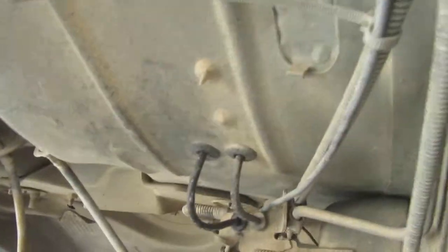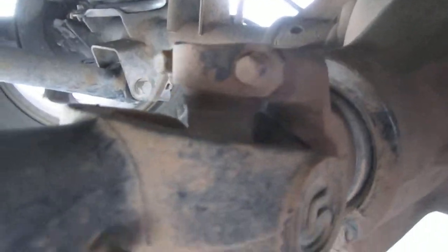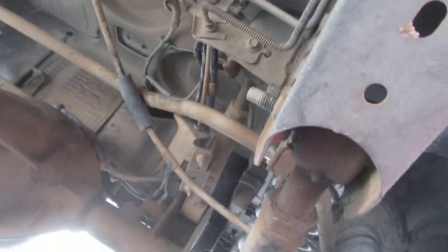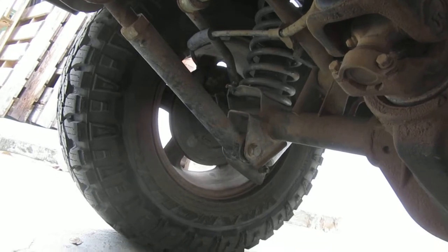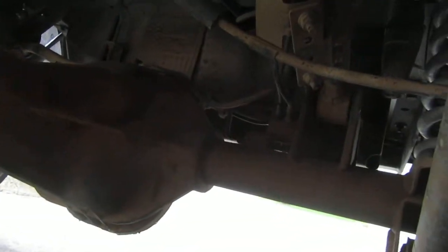You go down here — that's where the wires come out. The one on the right is for the right rear, the one on the left is for the left rear. Following along, it goes up on top of the differential and hooks up over there. I replaced that sensor but it lasted only about three or four hundred miles before the light came back. We figured out the right rear bearing is going out, and all the metal shavings are collecting on the sensor — that's what's causing the problems. Replace the bearing and that'll fix your ABS light.